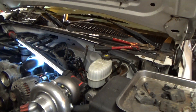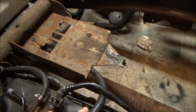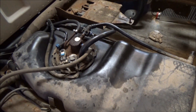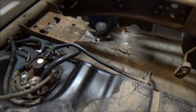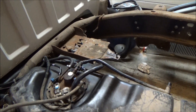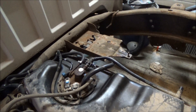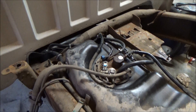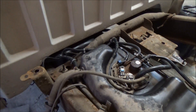Here's part of the fuel system done — we have the fittings on there, half-inch fuel line ran back, three-eighths return ran back. At the pump we've got the half-inch line connected to the filter, filter zip-tied underneath that tray, return ran and zip-tied in. We'll leave the bed off because it's easier and gives us space to do the exhaust. That ends the fuel segment — fuel is now connected and done. As soon as I get the part I need for the oil feed lines I'll bolt the intake down permanent, then get back to doing the turbos, their drains, feeds, and downpipes.